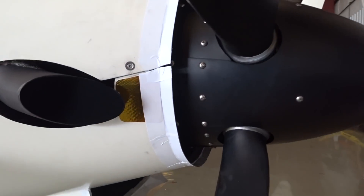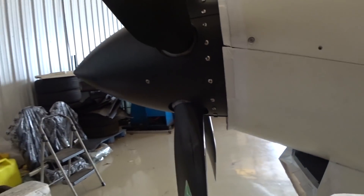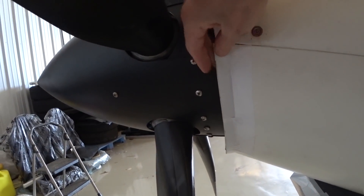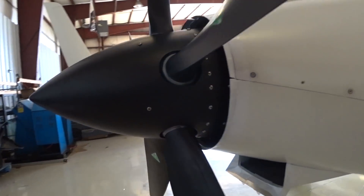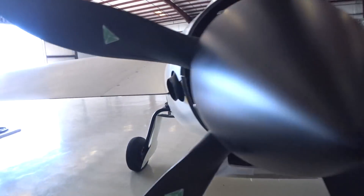I've also gone and created that bottom lip for the cowling. I think the upper one and the one on the cowling vent are working really well, and this is just going to give me more air pulling through the radiator and intercooler — so hopefully that'll be everything I need in terms of cooling.